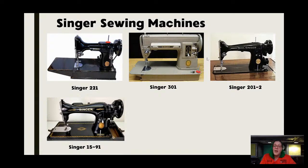That does not mean you can treat them like industrials — you can sew denim with it, but I wouldn't recommend sewing 20 layers of denim with it. Fashion leather, but not belt leather. They are gear driven, direct motor driven — there are no belts on either of those machines, and that's one reason they are so appealing. The one caveat is that they typically do need rewiring at the motor. In our shop you're looking at about $180 total for the service and the rewiring. The motor is very delicate — when you rewire it, there is a point of no return: if you clip that wire too short, your motor is dead. So that's one reason why it's costly, but they are excellent machines.